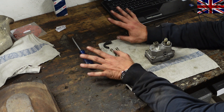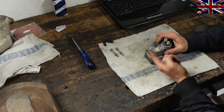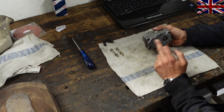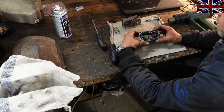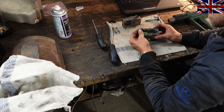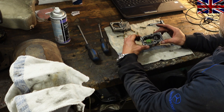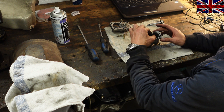That piece of curved vacuum line — see how stained it is on the outside — gives you an idea of how it looks on the inside. We now remove the bottom plate with four simple Phillips screws; do not lose them. Use a heat gun, it always helps. There are nuts on the other side — do not lose them either. This coil spring with that plate on the lower end is being compressed or released by the bending bimetal. Remove the coil spring, then remove the plunger with the metal plate. It actually looks all right — some gunk and residue, but basically fine.